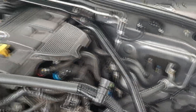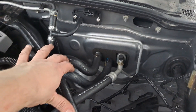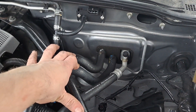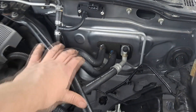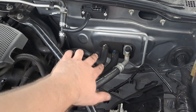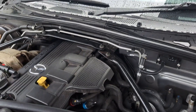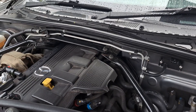What I'm looking to do for my water lines for the turbo is take it off these heater pipes. The turbo doesn't care which way around the water flows, so it doesn't matter. I've got some bits to tee into these and then I'm going to go across the bulkhead and into the turbo like that. I've got loads of fittings, let's dive into it.